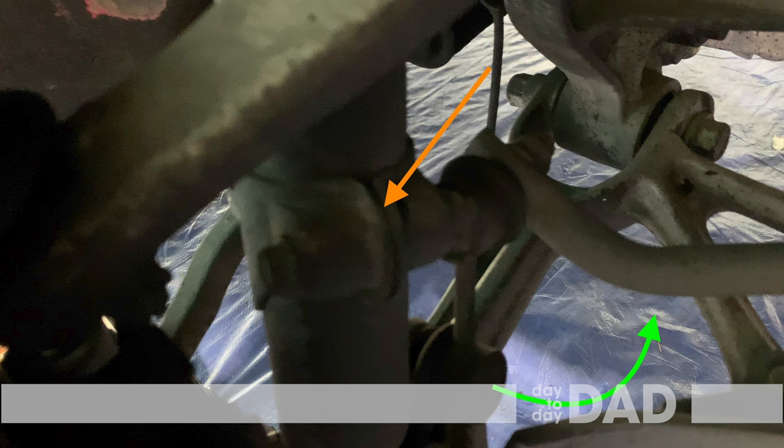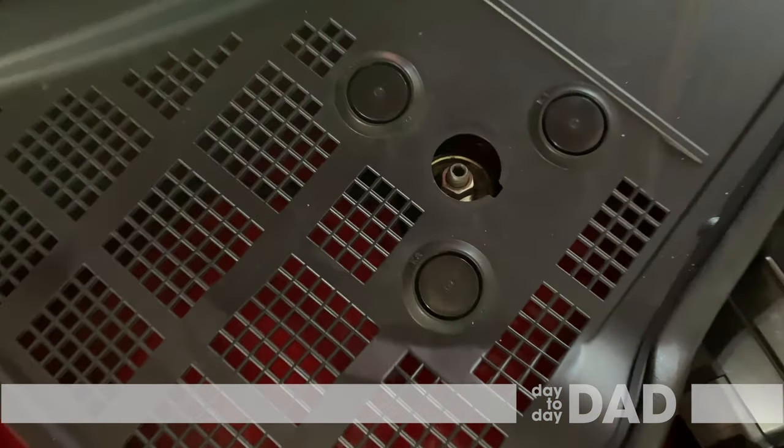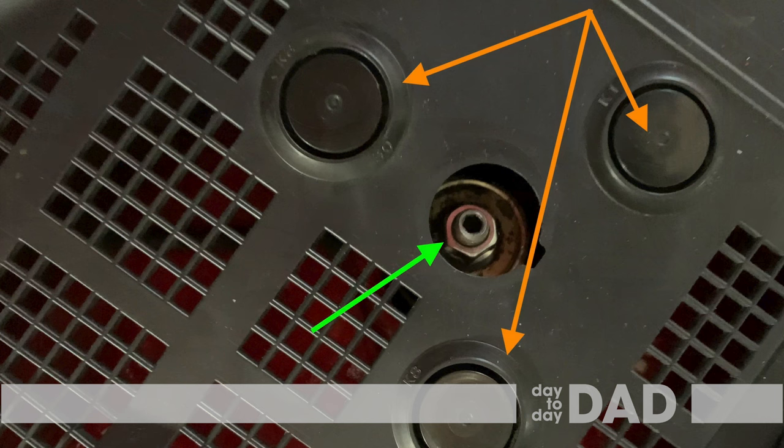If you remove the nut for the sway bar, it can rotate out, shown with the green arrow. At the top, the seated nut, shown with the green arrow, was 10mm by 1.25. However, the Bilsteins are 10mm by 1.50, so you cannot reuse this nut. You will need to purchase new ones if yours did not include them.